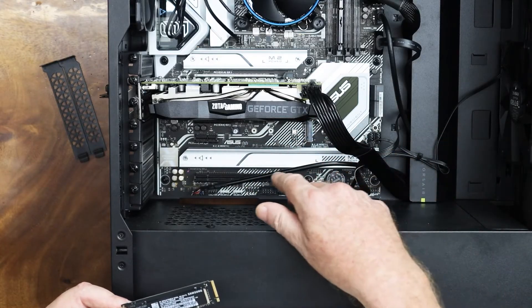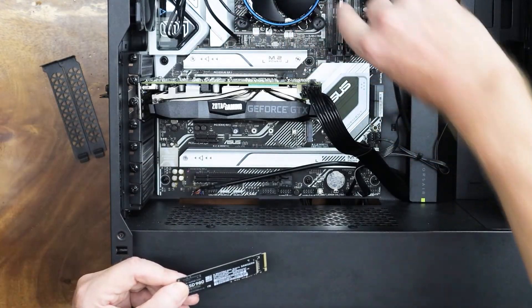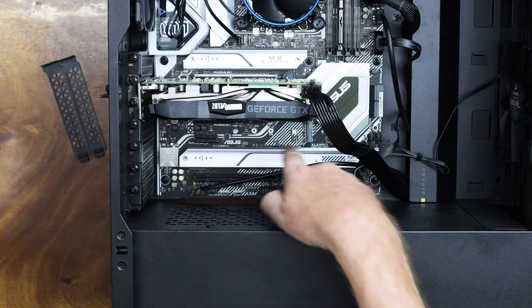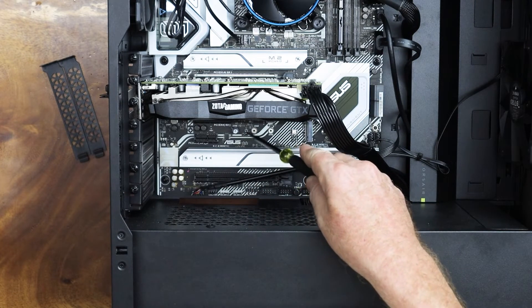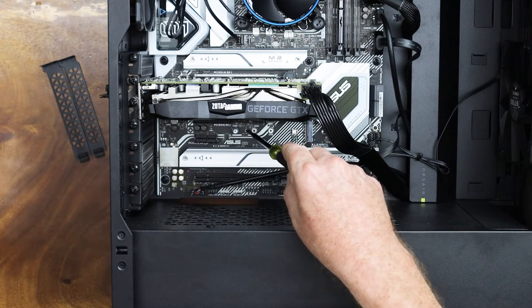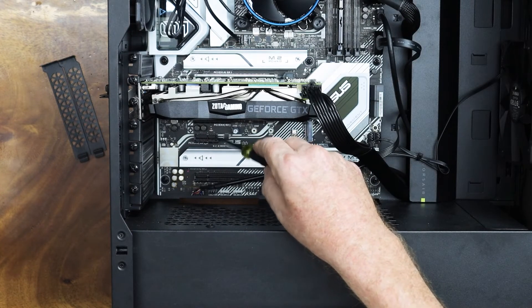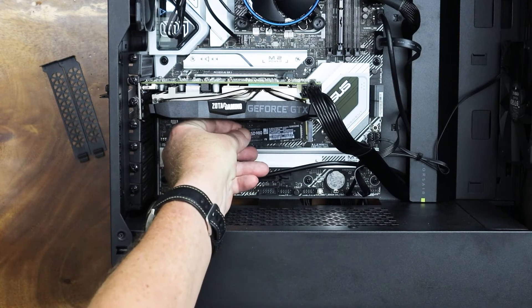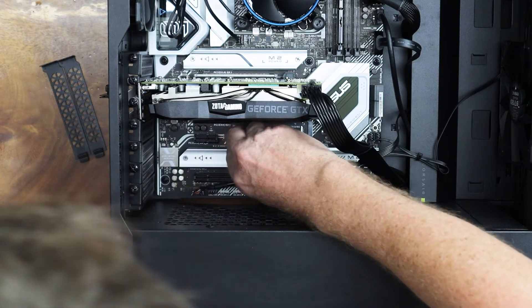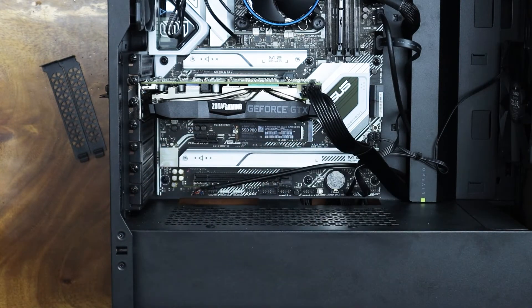I'm not going to put it behind the double heat sink slot. My main drive with the operating system is already in there — it's an 80 millimeter. Depending on your motherboard, there are plastic clips on this ASUS board, and you might have to move the clip if it's in the wrong place. This slot only takes up to 80 millimeters because we have card slots in the way. So we just get the piece like this, I'm going to put it in with my left hand so you can see, then you just turn this slot here and that locks it in place like that. It's so simple.